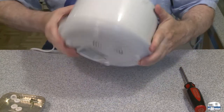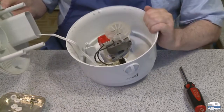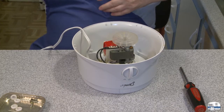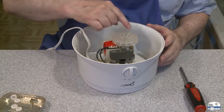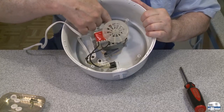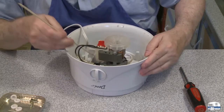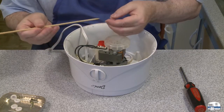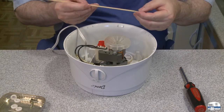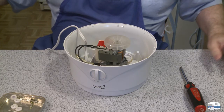I should be able to lift this cover off. The bottom comes off. I'll put that piece aside and get the cord out - I'll deal with that later. So here's the little gear assembly down inside there. This looks like it's a cooling fan, and this is the gear assembly down here. Let me get a little probe down there. See - that's like gum. That's the problem. The grease is all dried out. You'd think grease wouldn't dry out, but evidently it does.